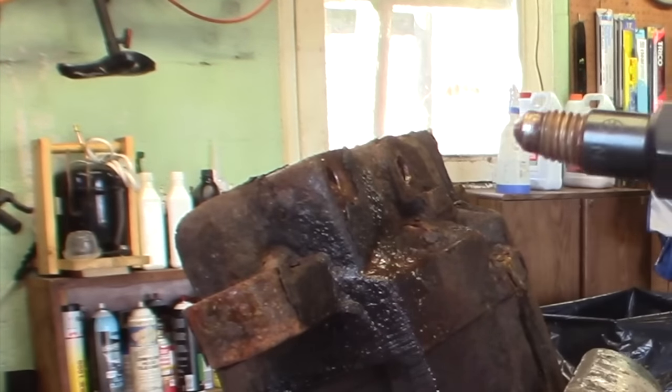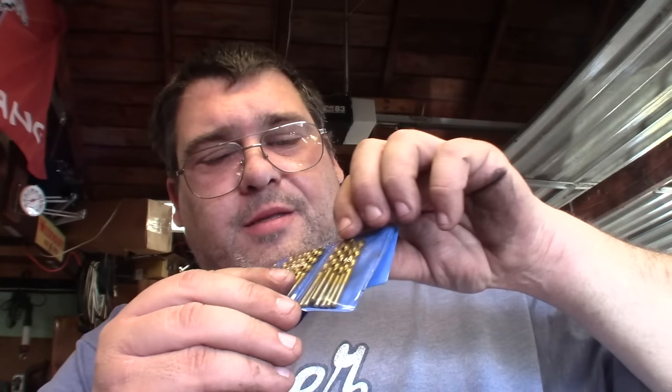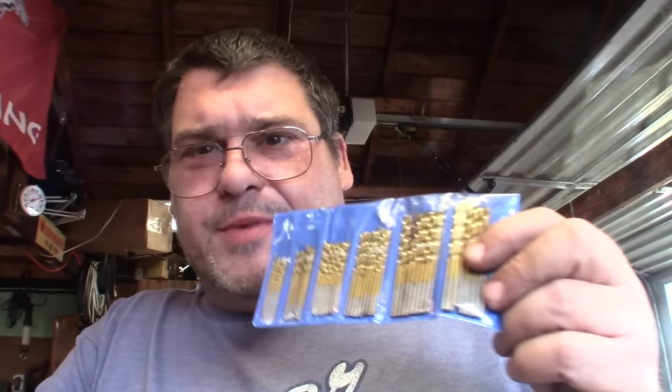Like I said, this works like 98% of the time. That method works really well for me. I know Eric O and others heat them up with oxyacetylene and maybe hit them with water - this is probably better because upside down the duster becomes like a liquid freon and freezes it real good. Whatever you've got to do to get that temperature differential to get some movement in the threads with the expansion and contraction. These little drill bits - see the link below or go to my Amazon store. I've gone down as far as 3/32nds up to 1/8th is normally what I use. You can buy this little assortment for about $6, or you can buy 60 of the same size for $10 - just handy to have some cheap drill bits you're going to essentially waste.